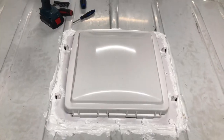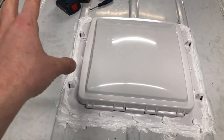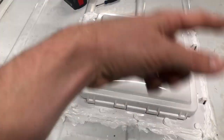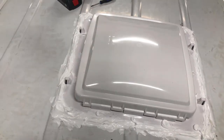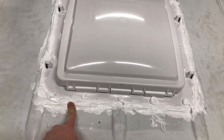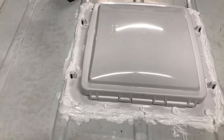Morgan wants me to show you what I did with the roof here. We dropped in two ceiling fans — we got the Max Air ones. I didn't really film it because there are like a million videos of this online, but I'll show you what we did. For the back one, we kind of just drilled a hole, or cut out a hole, and then lined the hole with butyl tape and then dropped it in. Then we put all-weather silicone in there.